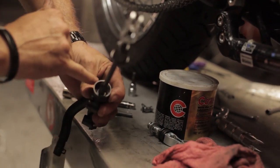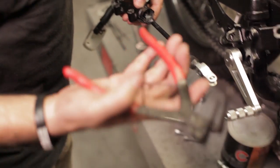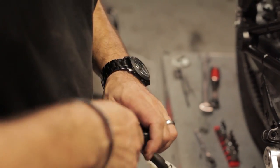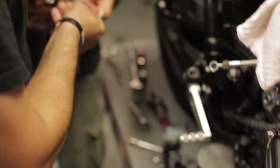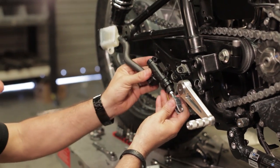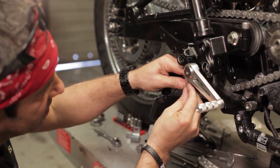Once that pops out, there's a circlip — it's fairly easy to remove. We actually have, and I think we provide these at the Diamond City store as well, master cylinder circlip pliers for use on master cylinders so you can get way in there. It works really well on these too. Once you get it loose, you can just pop it right out. You're going to reuse that circlip — put that right back on here, same way. So we've got the actuator in place and we'll get ready to mount this now. We're going to use the pin and clip that came with the other one and put that in here first to simplify matters.